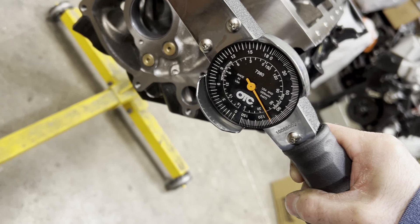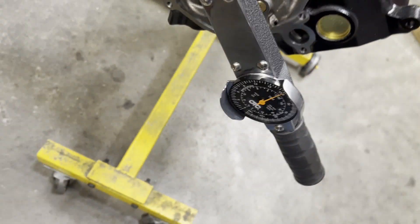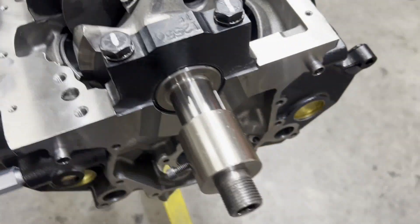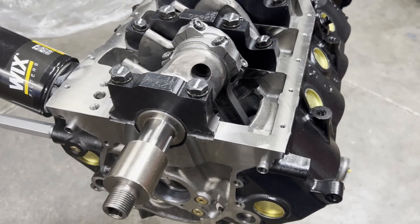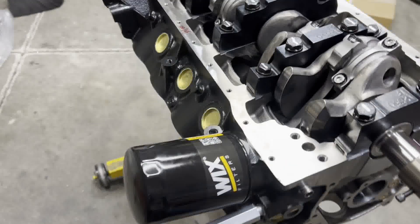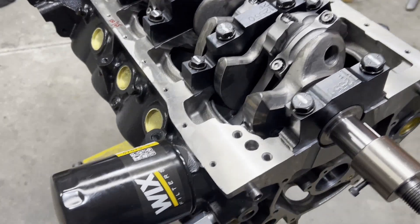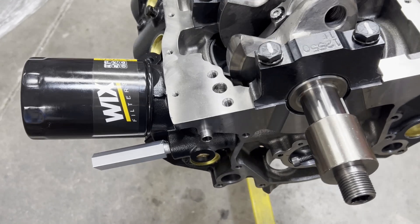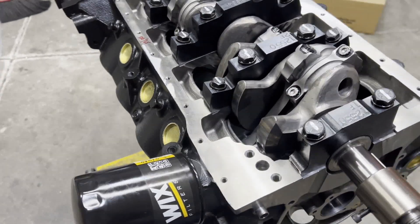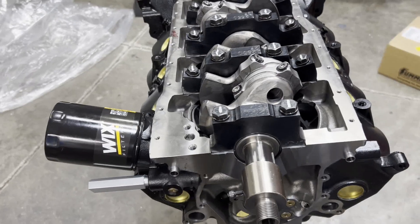About 100 inch-pounds once it's going — a little under — so we're talking about 8 or 9 pound-feet of torque to get this rotating assembly going. It'll go down just a little bit when the rings are seated. These combinations are just awesome. After fighting with FEs — FEs are probably one of the hardest engines to put together, with a lot of complex angles and geometry between the valve train, the intake manifold, and rear main seal stuff that you really have to watch your p's and q's on. Small block Fords are fairly straightforward and easy, so it's kind of a breath of fresh air.